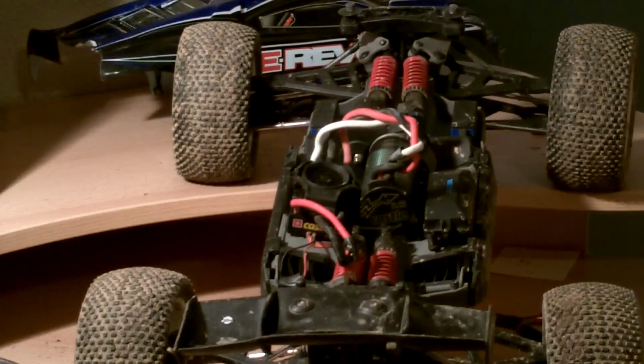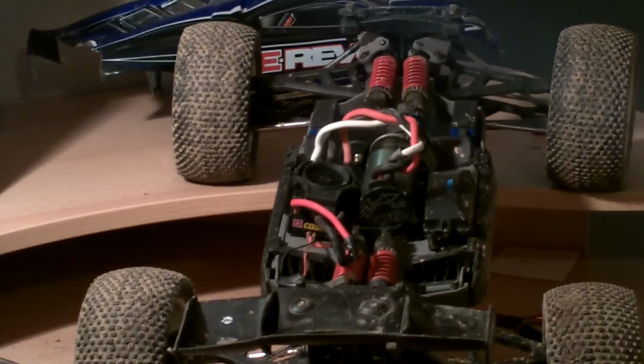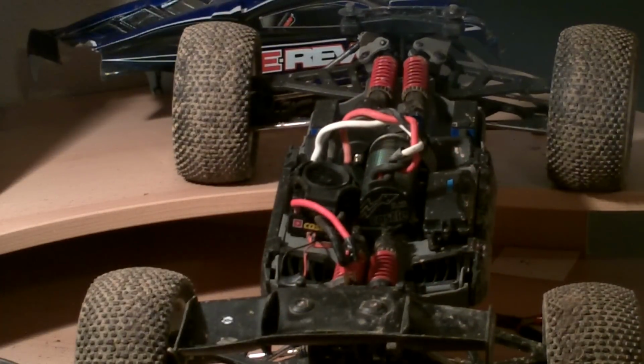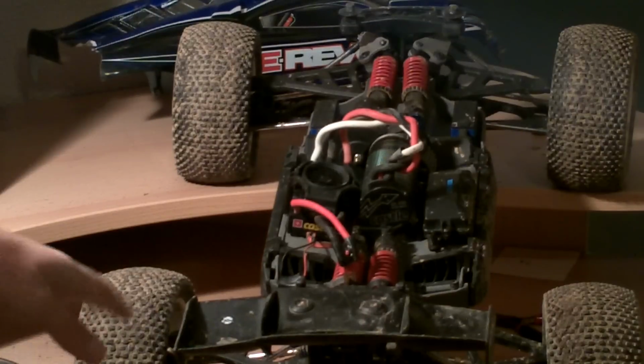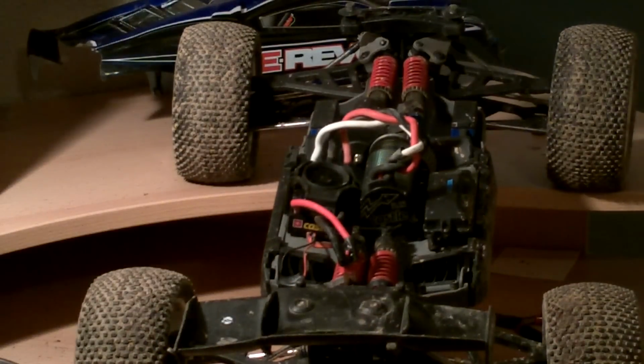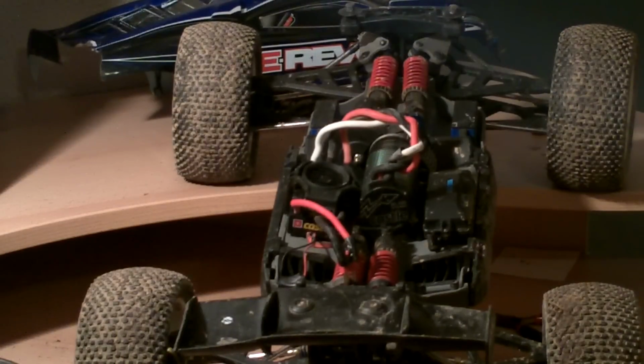As far as getting the suspension right, right now I have the Progressive 2 rockers on it. You don't get much ride height from that, and you're going to have to have your springs pretty tight to get your arms at least parallel with the ground. The spring rate on those springs is like 25 pounds, I think. It's ridiculous, and it's all because of the way the suspension is set up with the inboard shocks. So you have to have extremely stiff shocks.